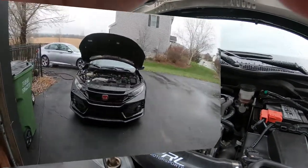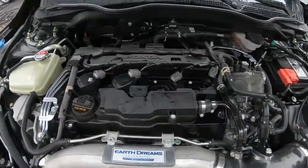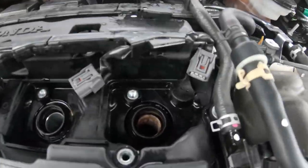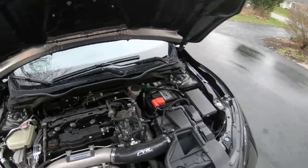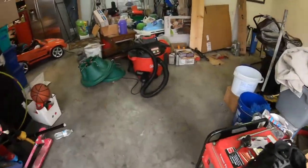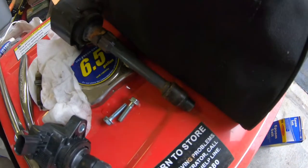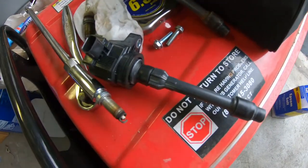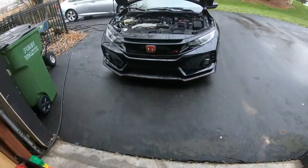What I'm doing here is swapping spark plugs from cylinder three to four. I got three out — take a look in there. Can you see how crusty that hole is compared to this one? This one is all wet, like there's water getting in, getting past the engine cover and going down into that hole. I'm gonna guess that's a problem. The plug from the crusty rusty hole versus the one from the number three hole — you can see number three is fine.